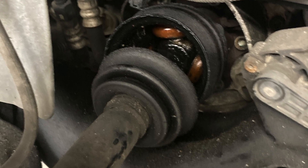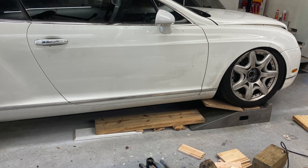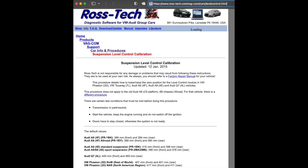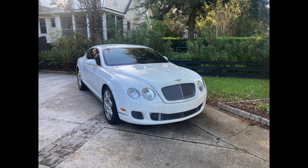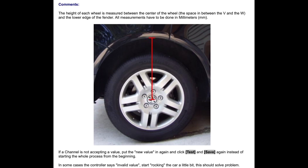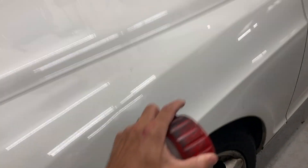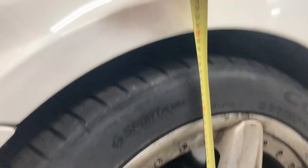The recalibration process is fairly straightforward but nuanced and must be done a certain way — the Autel website has this information. I had an Autel scanner; you log into the car with code 31564, go to the suspension module, and start on channel one. If you try to start on channel two or three it won't let you communicate, so you must start with channel one, which is the left front. The calibration value is the distance from the center of the hub to the bottom of the wheel well — it's a Volkswagen process, so use a metric tape and take that measurement.